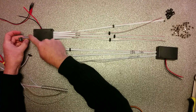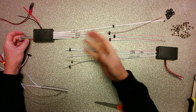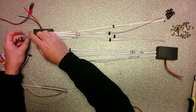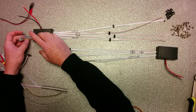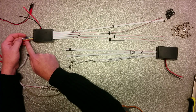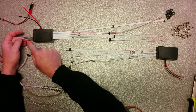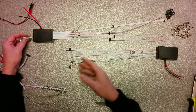When you use street mode, your rolling eyes follow the signals of your bike: red in the back, white in the front, blinking left and right in amber. If you want show during driving, which is illegal, I know, then you put 12 volt on the red one. Then it forgets about the street mode and it's always in show mode. If you don't connect this one, when your bike is on and when your lights are on, it will follow your lights.